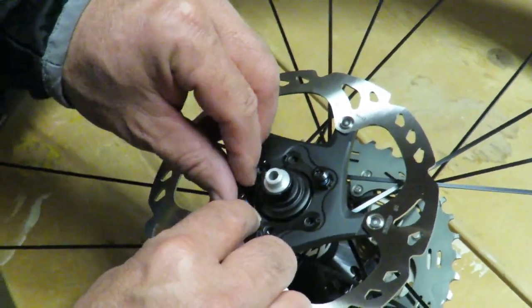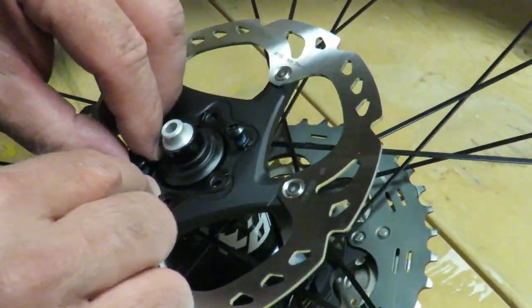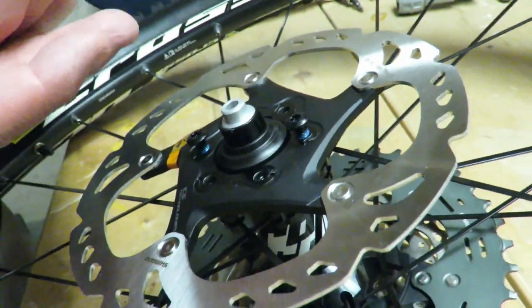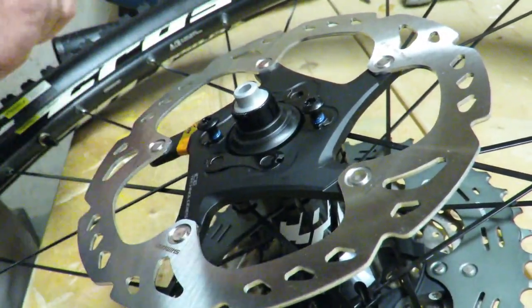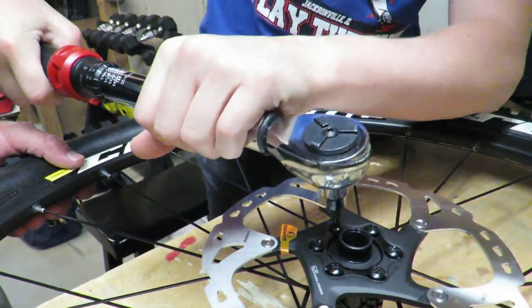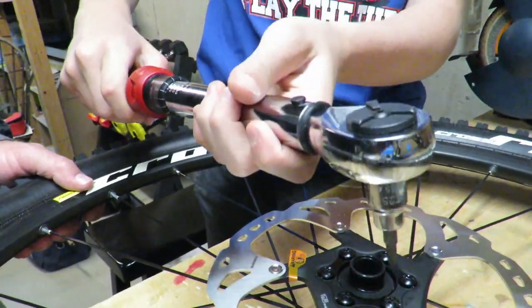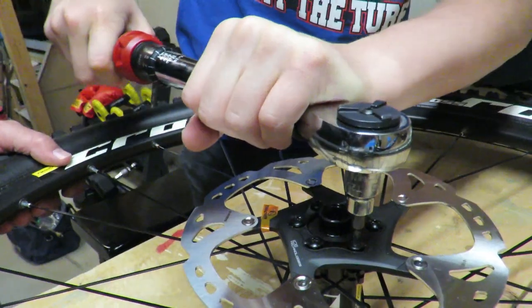You can cut the fork pipe with a hacksaw — in fact, if you have a carbon steering tube, you have to use a hacksaw and score it to show where to cut. We tried a tubing cutter. Next we installed the brake rotors. We went with Shimano XT SM RT86 rotors, choosing a 160mm rotor for the rear and 180mm for the front. Research showed that having a larger rotor in the front is ideal, as that is where most of the braking power should happen. There's a specific tightening pattern to ensure they lay flat and aren't damaged.